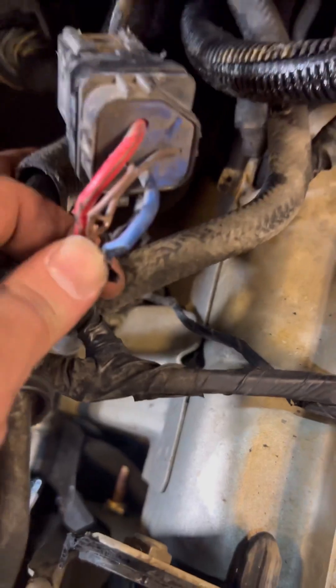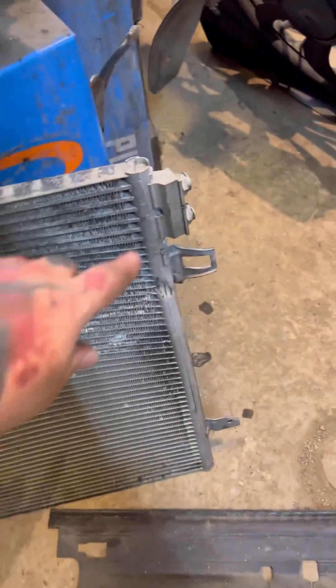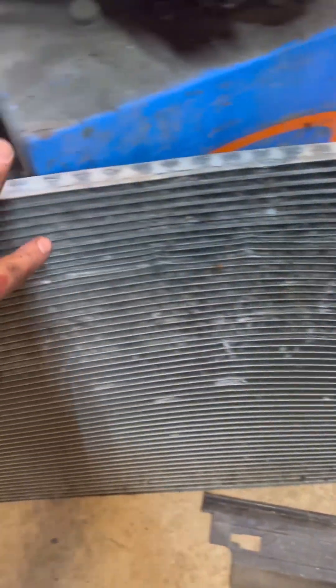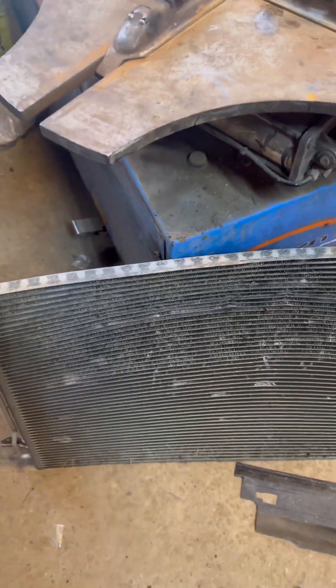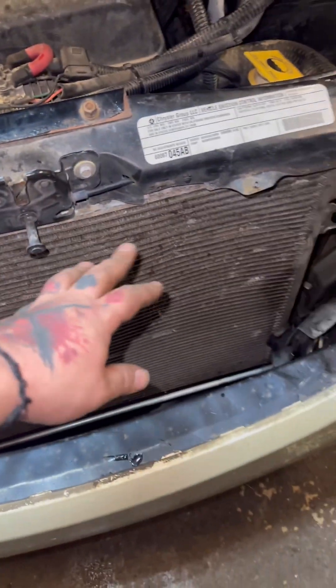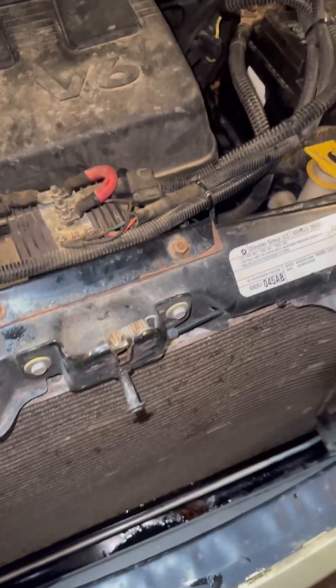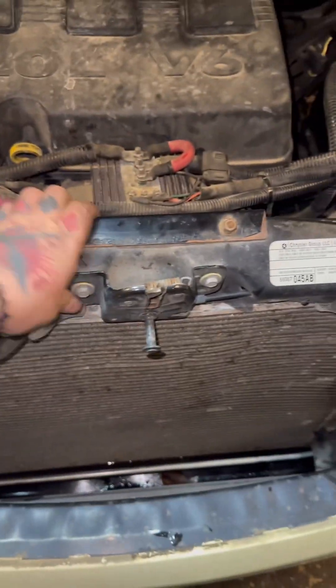Making some progress. Found some more shredded wires — I think that's the relay for the fans, so we're going to have to patch those up. The condenser actually doubles as a transmission cooler; the top part is the trans cooler, so I've got to reinstall that. There it is — trans cooler built into the condenser, back in solid.